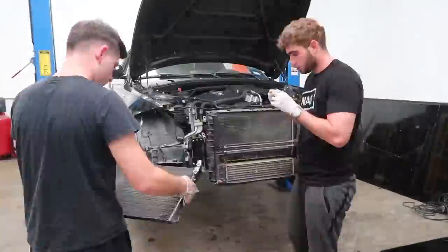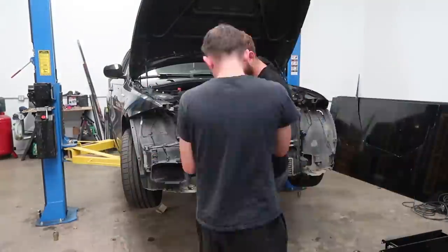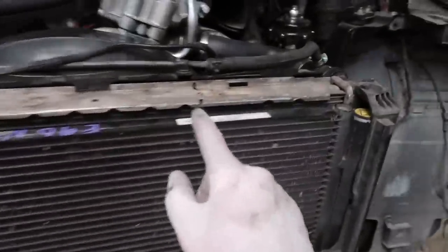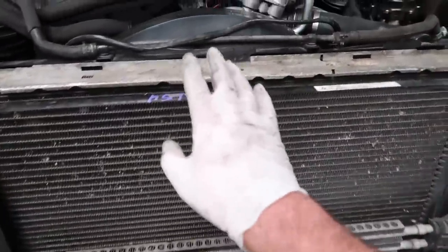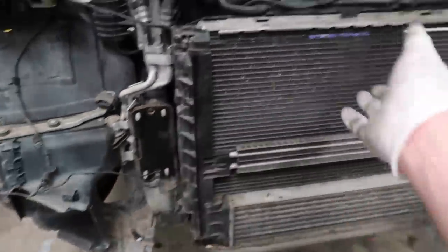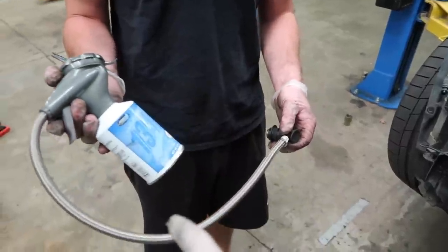This thing looks totaled, but we can fit in the condenser a whole lot easier now. So looking at it - we got the new OEM condenser. I went with OEM used because I just don't like aftermarket stuff when it comes to condensers, so I went with an OEM used one - about a hundred dollars, nearly the same as aftermarket. We got the AC lines hooked up - hope to god this is the issue. We're gonna go ahead and put in some refrigerant while the whole front clip is off. If it's still leaking, we want to be able to take it off easy and see if it's this or something else since everything's exposed. Let's put in some refrigerant and hope this car's got AC on the way home.